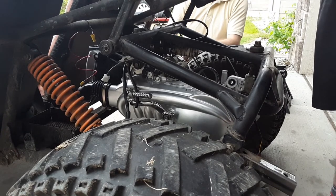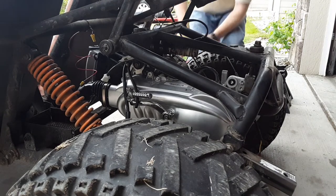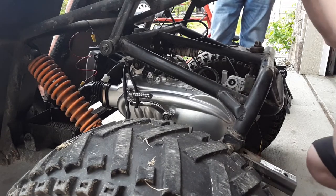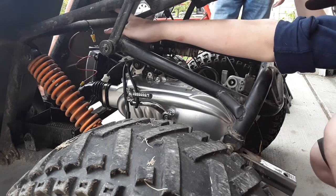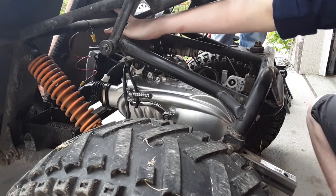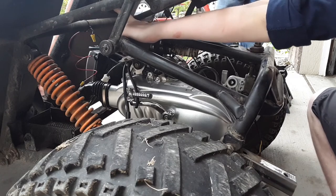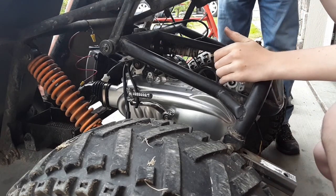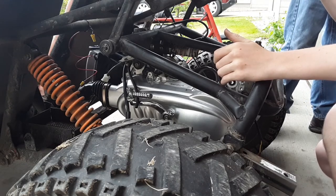Yes. Well, that makes things a little more difficult. But the valve on that doesn't open unless there's suction. So if you pull that off, it should only drip a little bit. It's not going to gush out. Do you have fuel line? Yeah, I do. Hold on. Where does the fuel line connect to on this? It's a smaller size. Quarter inch.